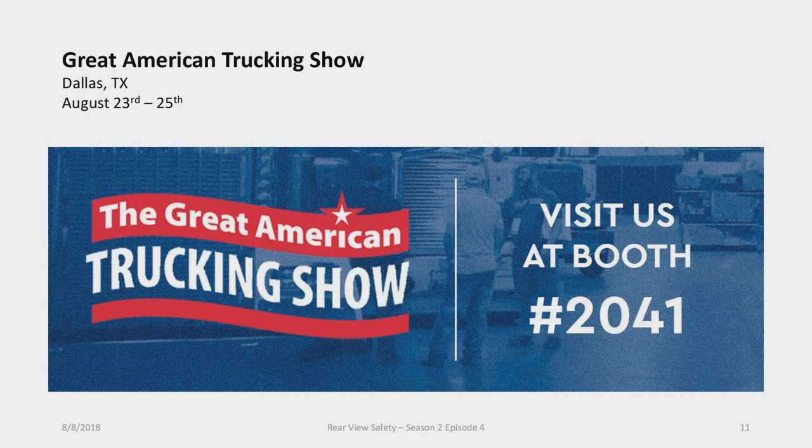Back to a question: on average, how long does it take to install a Brilliant Backseat Reminder system? It should be about a two-hour installation. The Brilliant Backseat system is a reminder system that alerts you if you leave something in the backseat — designed so you don't forget children, pets, or groceries. A button installs inside the backseat, and when you finish a drive and turn off the vehicle, you have to open the back door and press that button or the alarm sounds. You just need to install the button and tap into the door wiring.